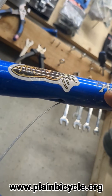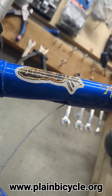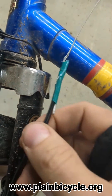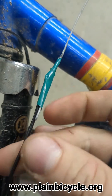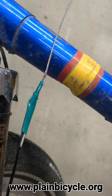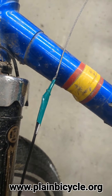You use a flashlight to look up in there, then use a little hook or carefully twist the wire around until you can poke it out. Once it's out, you bring it over and tape your electrical wire on there. Make sure it's secure because if the tape comes off halfway in there, you've got tape inside your frame and you've got to fish it again.